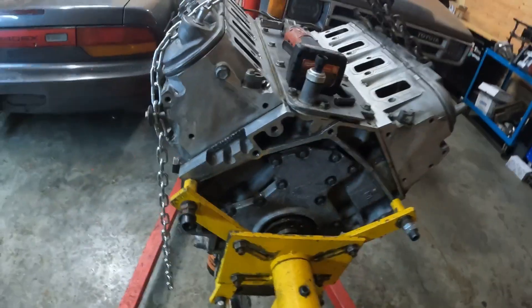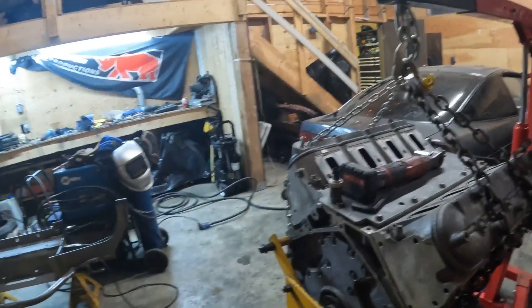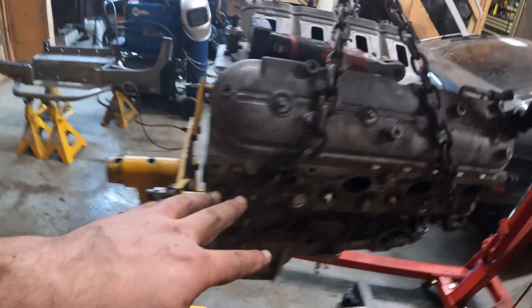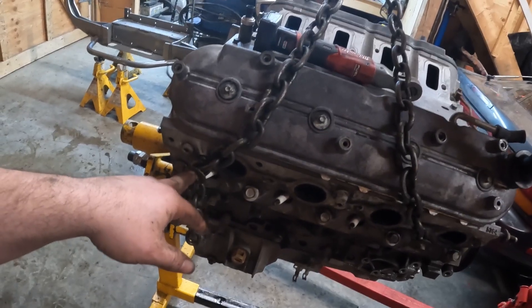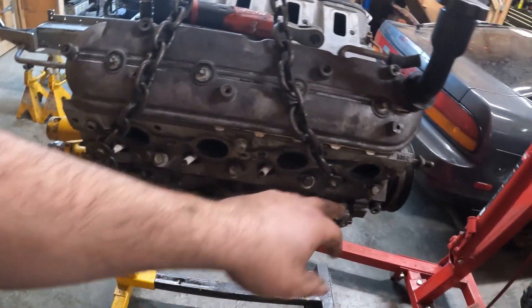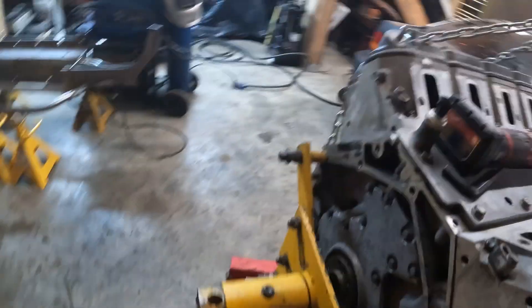We're all cleaned up over here. If anybody's wondering how long it takes to clean a motor to 80 percent - I didn't do the best job but about two beers and three smokes later she's pretty clean. I also had four broken exhaust manifold studs or bolts in these. Three of them were broken pretty nicely and I was able to just get the vice grips on them, but one of them was broken off inside. As you can see here, I had to do a little welding and surprisingly everything just came out - no hassle, no drilling, no bullshit.